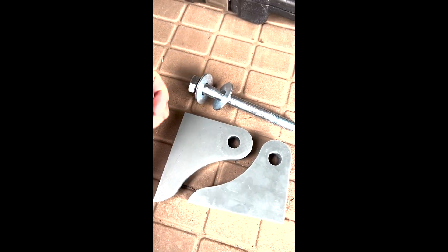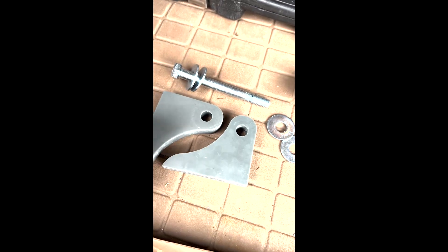Here's what I'm sending you: two sides of the plates, four bolts total, washers — two on each side — and then the nut. Here's how you're going to install it. This is your coupler right here — you're going to orient it like this, and then you can see through the hole right here, so the bolt's going to go all the way through those eyelets.